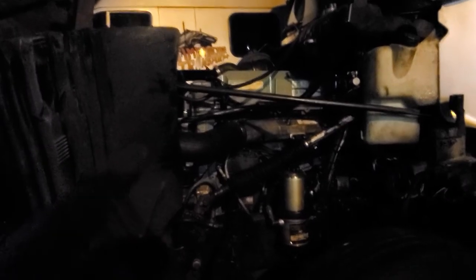Like I said earlier in the video, it's dark out — we just got out here just before it was getting dark. We put our battery charging truck on and I got another spare battery on the other side hooked up with cables. But she started, and that's the reason I'm doing this video. If you have a truck with all this new stuff on it and she was cranking but not starting, it's not going to be a battery issue or a power issue. That's why you go to your air filter and spray starting fluid in it.